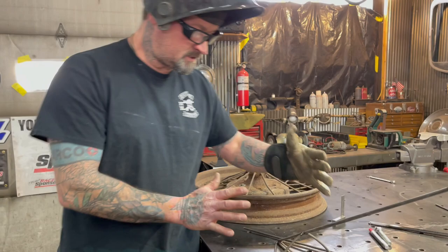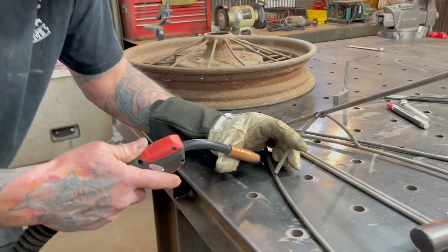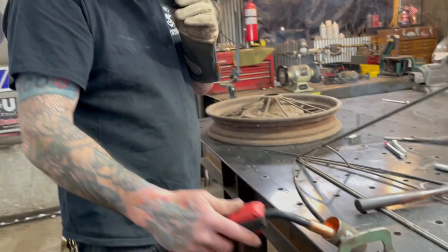The closer you get these to where they match exactly on these wire form bucks, the better — because it's less stuff that you have to fight later. If you read books or watch specials on these vintage Italian style coach built cars, you'll realize that even like Ferraris and whatever, a lot of times the coach builders would build these cars by hand and sometimes there'd be a front fender that was 5/8 inch out compared to the other one. So it's normal to see stuff that's not exactly 100% perfect — you're building this by hand, not with a computer.